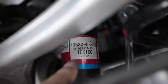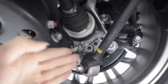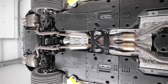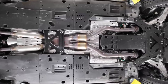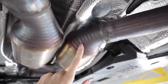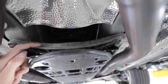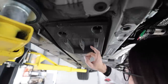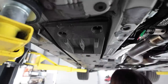Out back you have a multi-link rear suspension comprised of both steel and aluminum with Tokico struts — the rear knuckles are also made out of aluminum. There are some extra machined holes for some other type of application. Lilac and light blue coated hardware — that's what's up. A Garage Science wouldn't be complete without the slow panning underbelly shot. Lots of plastic down here to keep things slick and aerodynamic. The driveshaft is above the heat shield over the all-stainless steel exhaust system. There's fairly significant bracing underneath to keep the chassis nice and stiff, with a finned plastic diffuser panel underneath.